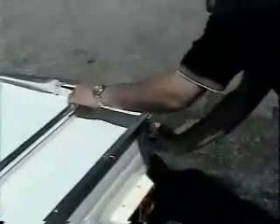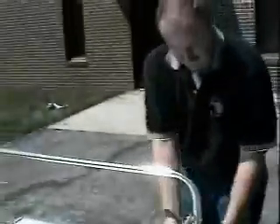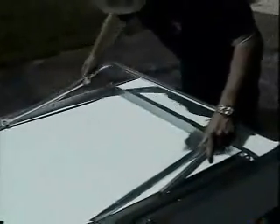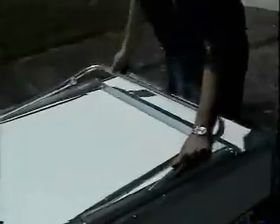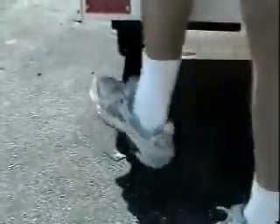You'll usually find that one corner is tighter than the others. If you just grab hold of the rack, pull on it, and push down on the latch, you can slide it over the corner. The only other thing is to remember to put your jacks up before you start to leave. The easiest way is to step on the top of the jack, put some weight on that, and then release the jack so it will compress. Go around and do that to all four of them before you try to fold them up — that way you've got enough clearance to put the jacks back up.